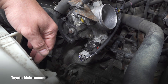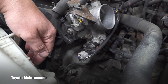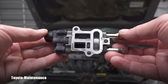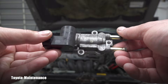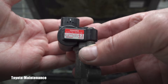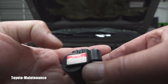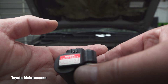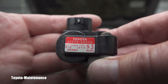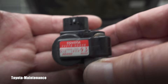It has rust and corrosion inside and therefore it's not moving — so it's defective. I have a new one, and that gives me a chance to show you the difference between the one which doesn't work and the new unit, which we can install in just a couple of minutes. I've disconnected this valve for the purpose of this comparison test. You can see the three-pin connector. Last time I read you the part number which Toyota still sells — I made a mistake: it's 22270-0D, as in David, 0404. I was reading that D as a zero in the previous video, so I apologize for that.